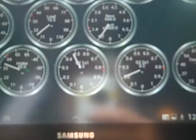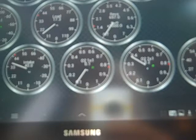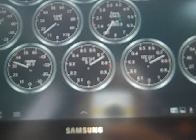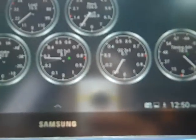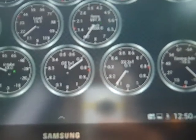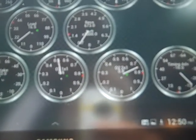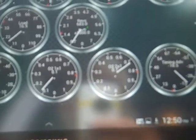I use this for following how my sensors are doing. You can see that my oxygen sensors actually need to be replaced, because I'm skipping all over the place at the moment. Normally they should sit a lot closer to 0.45. I have two new ones ready to go in the box - I've just not put them in yet.